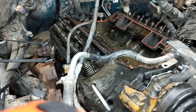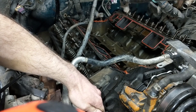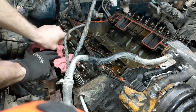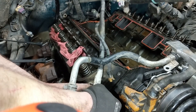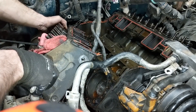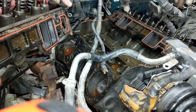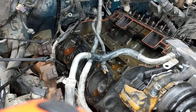All right, let's wrap it up — about ready to pull this head off here. Once the heads are off we get to do the very fun part of cleaning, and you've got to take the heads to the machine shop. Cleaning is going to be tedious, boring, and time consuming — there's going to be a lot of it and it's very important that we get it all done. Once the heads are off, take them to the machine shop, have them checked out and machined if needed. It's a good idea to get all the valves ground, new seats, and seals — the whole nine — really the best way to go. Cheaping out at this point would be counterproductive. Next video we'll start cleaning things up.